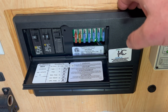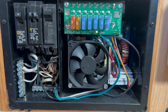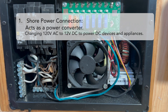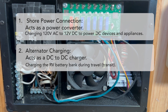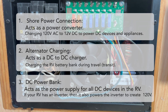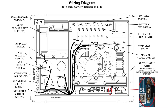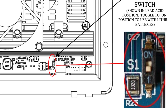If you want to complete this system, you'll want to tie in your power distribution center, and you want to make sure it has the ability to work with lithium batteries. The power center works with your battery bank in several ways: when connected to shore power it converts 110-volt AC to 12-volt DC to power all the DC devices; when driving, many power centers can take power from your car's alternator to charge the battery bank; and when dry camping or boondocking, the battery bank powers the 12-volt devices in your RV. My power center is a Progressive Dynamics 4100 — I purchased it because it can switch between lead acid and lithium batteries. There's a PCB in the back with a switch, so I just need to find that switch, flip it to lithium, and we're good to go.